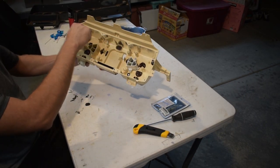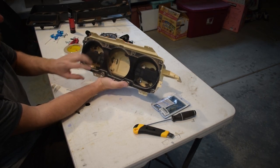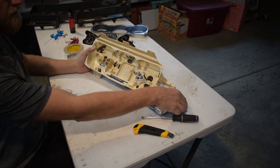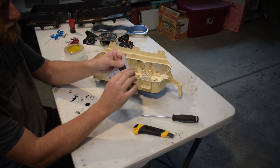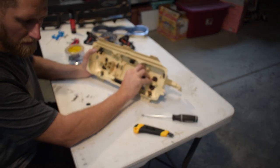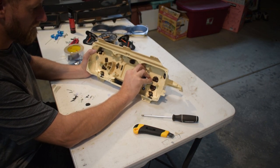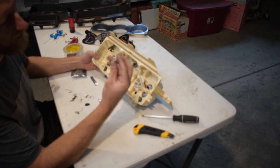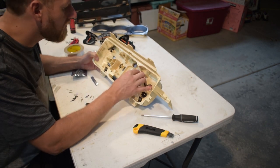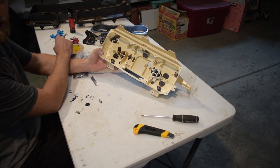We got that aluminum tape all around the borders except for the block-off plate, which is visible with the top on, so I didn't cover that. Now it is time to change the bulbs out. These are the LEDs I'm going to use — I've got a link to these in the description below. The easiest way to remove the old ones is to gently wiggle and pull from the front. We'll change all six of those, then move on to cleaning and repainting the needles on the gauges.